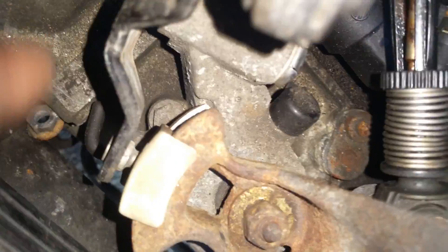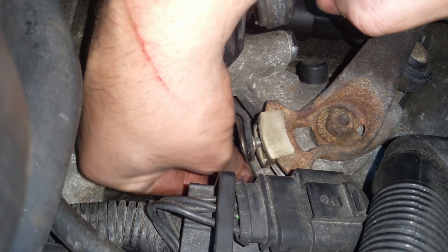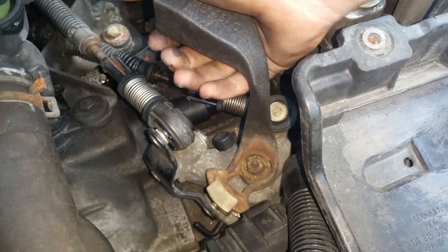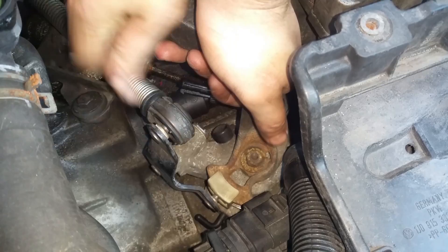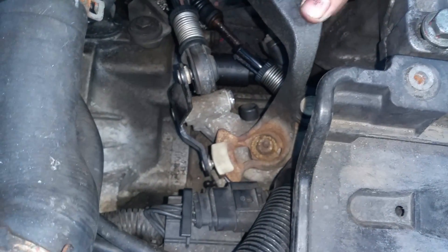Now I've got to give you guys a deep look. See this little plastic tab sticking off here — this little L-shape right there? That's the neutral lockout. What we have to do is push down on the counterweight, and you'll feel it rotate the whole assembly down. We're going to try and lock that pin inwards, but be very gentle with it — it's only plastic and you can shear it off quite easily. To make sure you're in neutral, the whole assembly should be able to go up and down. Find where you can still pull it up or down, then with it pushed down you should be able to rotate this locking pin in. Now the L is facing up — we're locked into neutral.